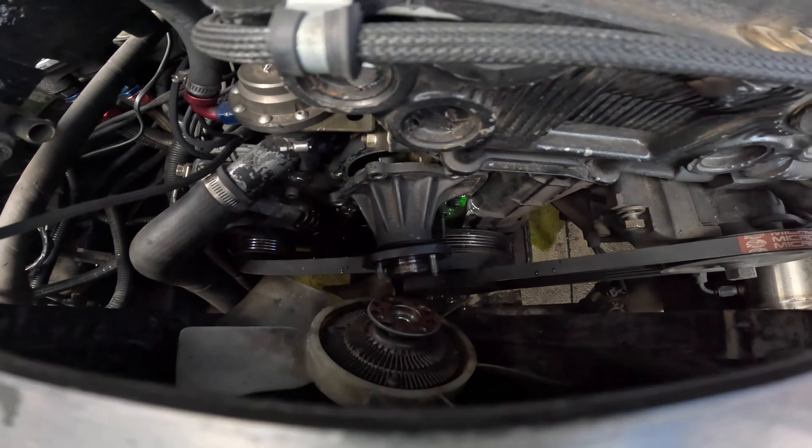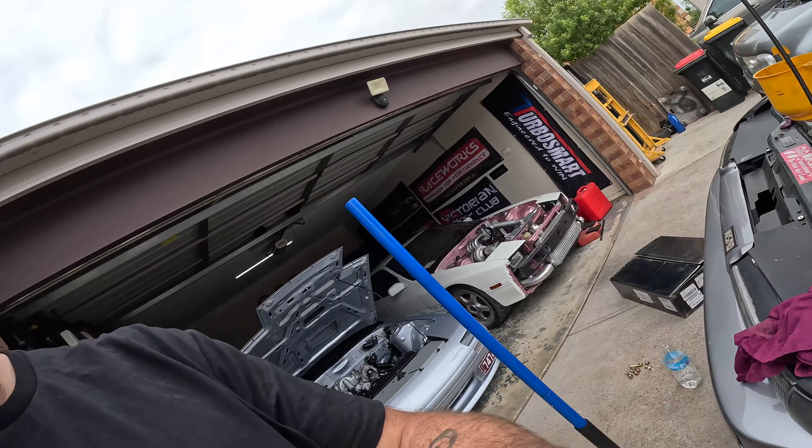She is fixed. New water pump in there — just bleeding the last of the coolant up. The car is running like absolute shit though. Sounds like a manifold leak, a good vacuum leak — there's a bit of a squeal coming from the intake somewhere. At the moment it's much of a muchness because I can't get it into the garage, otherwise I'll start ripping everything off. So let's test these bloody coilovers.